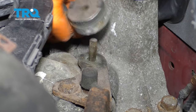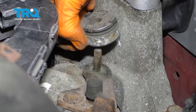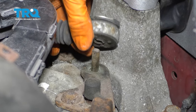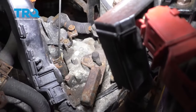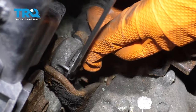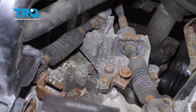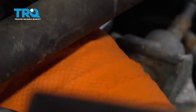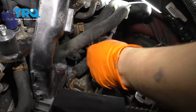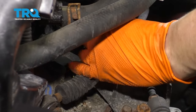What I need to do now is pull this shifter cable up and off of this stud here. Sometimes these don't come off and they'll be stuck, so you'll have to spray them with some rust penetrant and just work them back and forth. Thankfully, this one did come off. Do the same to the other one right here. Pull the shifter linkage off, leave those aside, and then I'm going to disconnect this bracket with three 12-millimeter bolts.